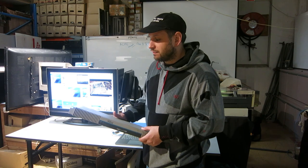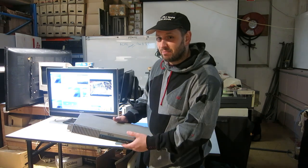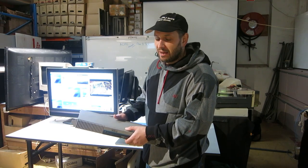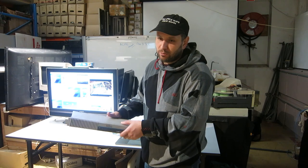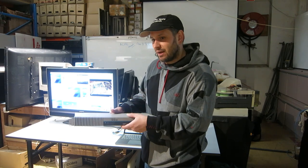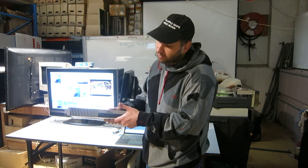It would also allow you to browse an AppleTalk network. What I absolutely love about them is that if you dial into this from an old Mac running MacOS 7, 8, or 9 and set AppleTalk as remote access, you can actually see all of the AppleTalk printers and network servers locally on the network from a dial-up connection — which is just awesome.